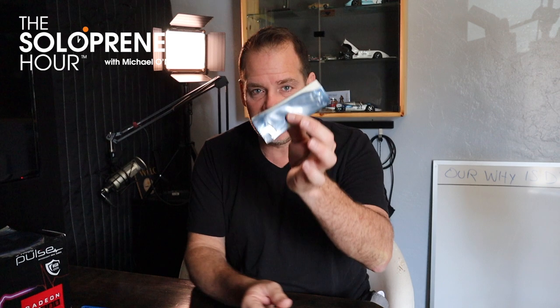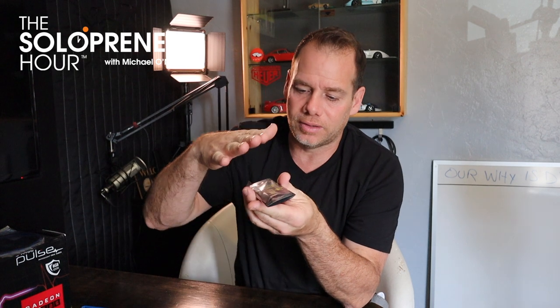I forgot to note: these CPUs I got from eBay are de-lidded. Normally they have an aluminum top on them, but these do not. If you want to update this particular machine, you need a little more room, and if you have the lids on it's two or three millimeters too high. So these are de-lidded. You just have to be careful when you tighten the CPU heatsink down - you'll see me do that when we're done updating this firmware, which has 19 minutes remaining.